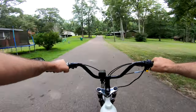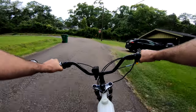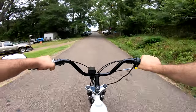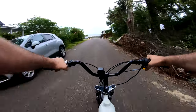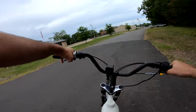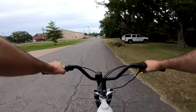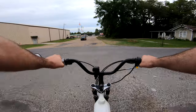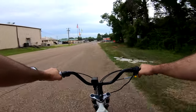Now, I've been told from experienced builders that there can be differences between brands and manufacturers of these MS460 pistons. I'll leave a link in the description to the one I got, but I think at the moment, at the time of recording, it's unavailable. You can search for other options. I assume that they're going to be pretty close in specs, but I can't guarantee that every manufacturer's MS460 piston is going to be safe to run. So make sure you check carefully for clearance, squish gap, and any other issues that you think might come into play.